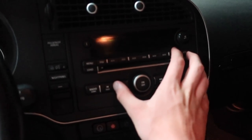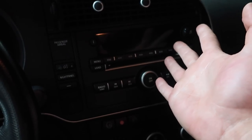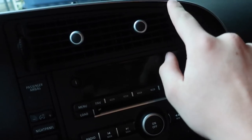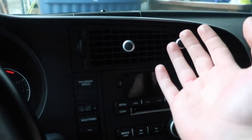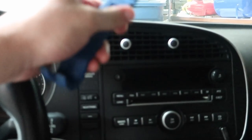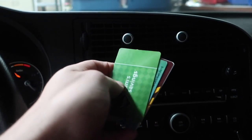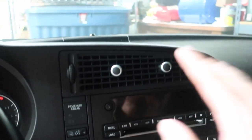Removing the physical radio from the car is not difficult — it's literally two bolts and like three connectors. But to get to those, you have to remove the air vent, which from what I've heard is very difficult. From watching a couple of videos, there are six clips you basically have to push in simultaneously — three on the bottom, three on the top — and it'll come out all in one piece. The trick is to get a plastic pry tool to make a little bit of space, then stick cards in where the tabs are and slowly wiggle it out.